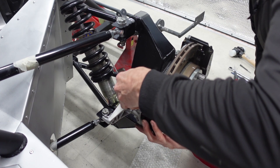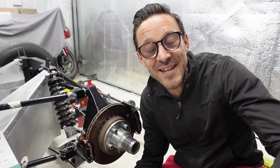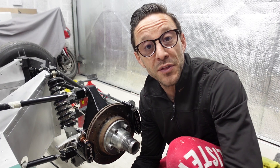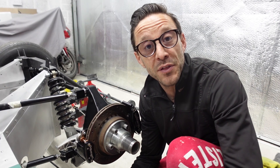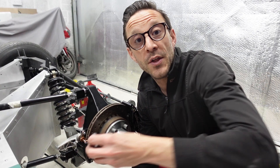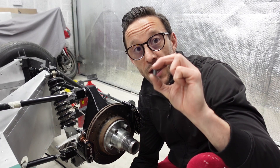On to the fitting of the handbrake caliper — everything lined up perfectly as you'd expect. Using the bolts and washers supplied by Tornado, the handbrake caliper bolted up an absolute dream. Everything fits perfectly; all of the necessary hardware has been provided, making it very straightforward. The only remaining step is connecting the handbrake cable to the caliper. Tornado provides everything needed for this: a custom-turned ferrule that fits into the underside of the caliper, the handbrake cable runs through there and gets pinched up with another supplied ferrule that locates in the top part of the caliper.